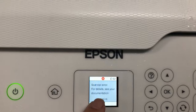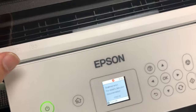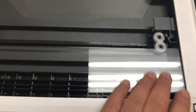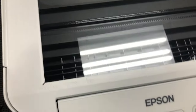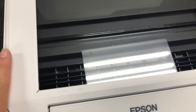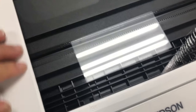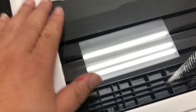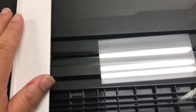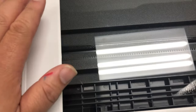This problem may be caused by a couple of things. When you start the printer, the printer will try to move the scanner unit to the left and scan a small patch of white as a signal that everything works okay. The printer doesn't have eyes, so it depends on a couple of sensors. First, you might have something physically preventing the scanner unit from moving to the left.